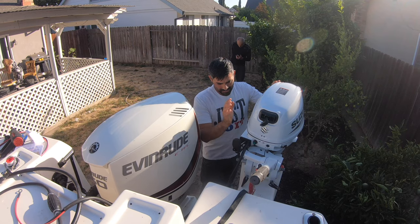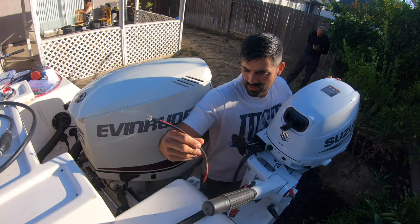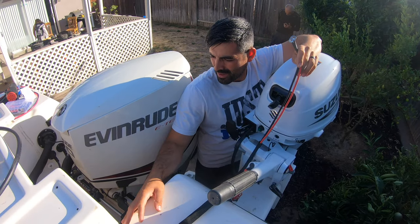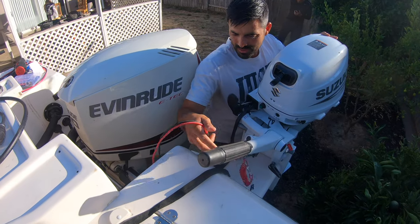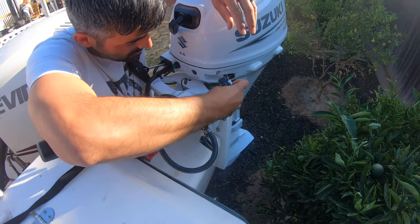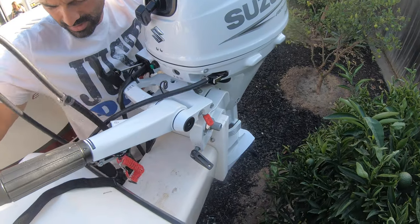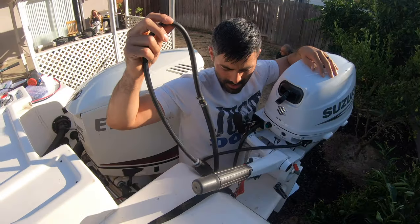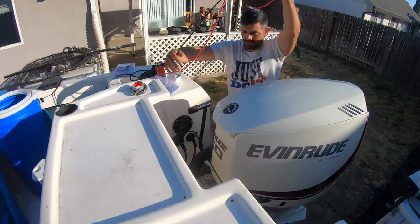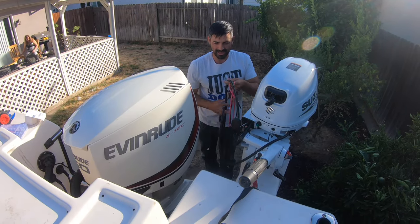Okay, perfect. So now that we have the motor mounted, we have it completely secure. We were gonna try to turn it on, but we realized that the cables were a little short. So we went ahead and bought some extra power cables. I bought an extra 5 feet so that we can put it towards the battery and it doesn't have any issues once we move it. And this comes with the engine, so it's a quick connect. This basically goes right here. You see it, two starts and it just connects just like that. And then this we just connect to the water fuel separator. I'll show you guys right now and that should be a quick connect. But right now what I need to do is splice these wires so we can add it to the main line, get a little bit more footage here, and then that should run to the battery.